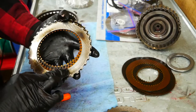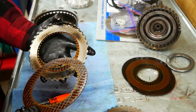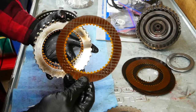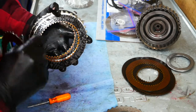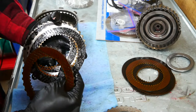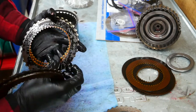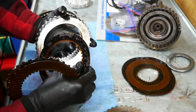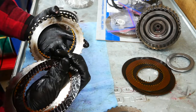That one is burned as well. So far, every clutch pack that we've had has been burned. The clutches actually don't look that bad — you can see they're burned on that side but not on that side. It's tan and black. This one's missing chunks out of it all the way around. It looks like maybe this transmission was just run out of fluid — look at all that friction material gone off of that. The rest of it still had a little bit of padding in it.